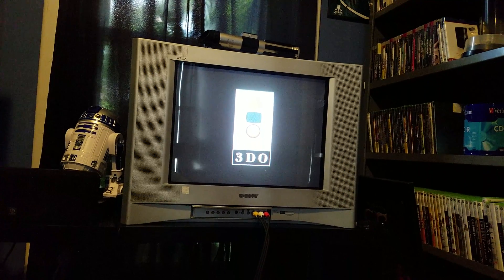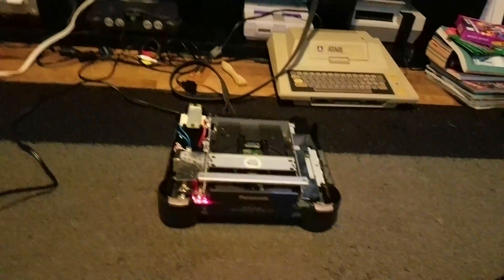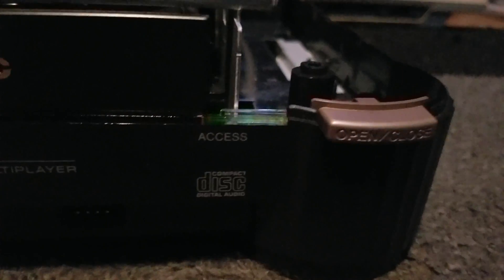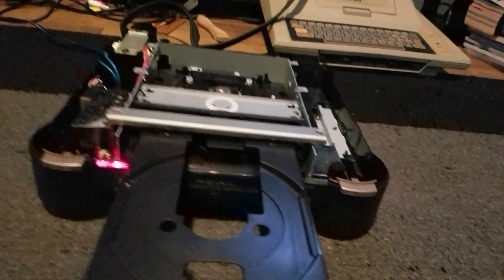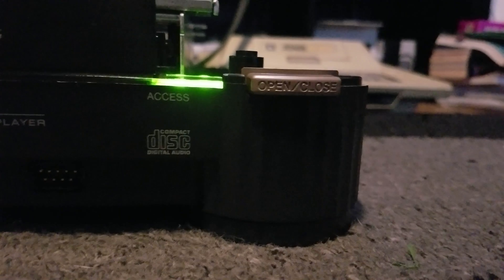What's unusual, and why I'm thinking it may not necessarily be a laser problem, is that you can look at the very front and very dimly the access light is just constantly flashing. I'm not sure why — it's not the same intensity as, say, when I eject and put in a music CD. The intensity is actually much brighter when it's trying to read.